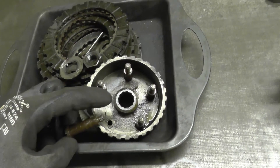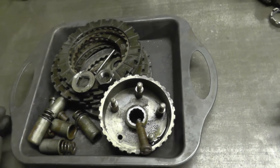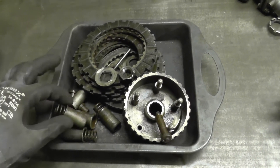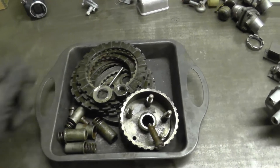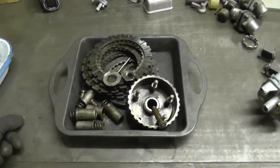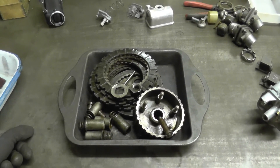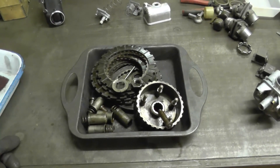You can see the end pulled away there. Apart from that, the clutch again looks quite good — needs a clean up, there's a bunch of surface rust in there. The ends of the spring cups haven't spread, which can happen on older bikes where they bottom in the basket and you end up with a slipping clutch even though the plates are in good condition. So I think my next job is to make the puller tool — I'll do a little feature on that. And apart from that, it's making a parts list to order carburettor parts and things like the nut and seal.